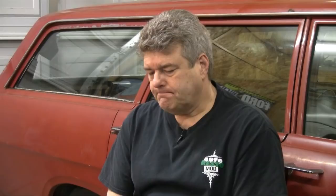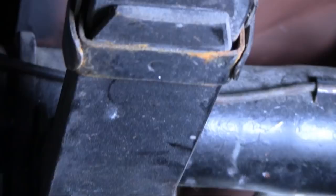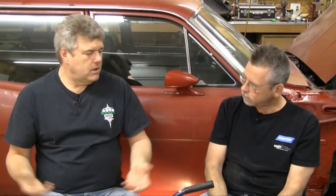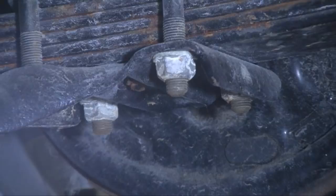One of the things I ran into with the '67 was the undercarriage. When we blasted it, I didn't clean the undercarriage like I cleaned the top side. The soda — had I been leaving the original brake lines in the car — etched the metal. All of the things underneath the car that were anodized or plated, all of those were corroded. I've gone in and fixed all of it, but that's a hassle to have to go back in and do — unless you're taking the entire car apart after you've soda blasted.